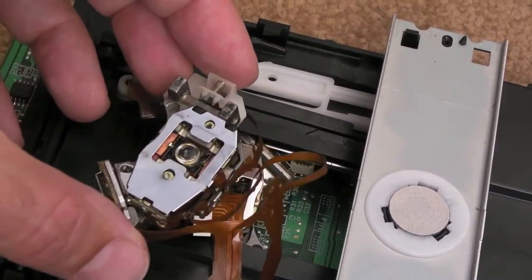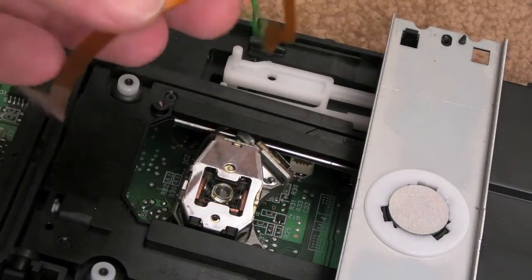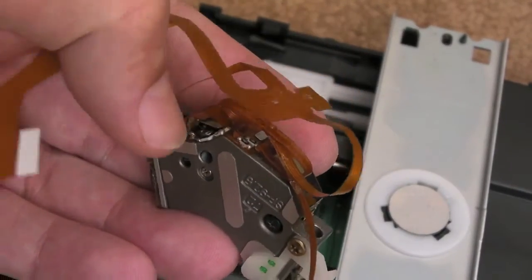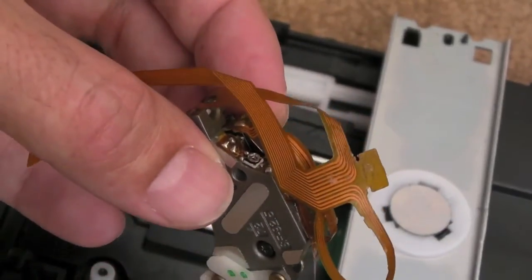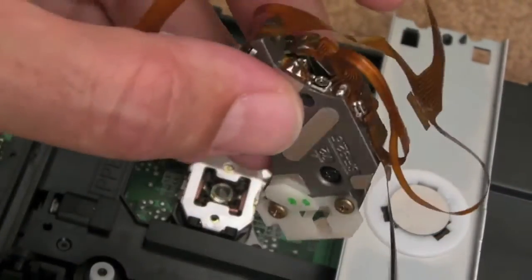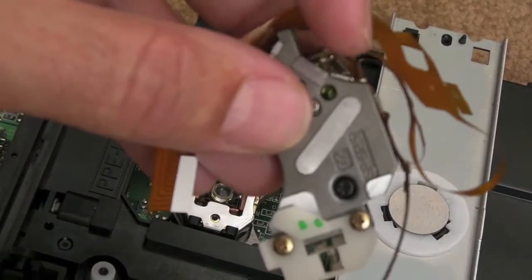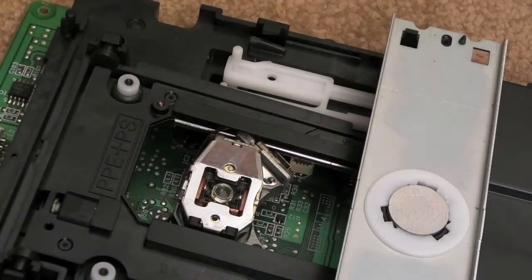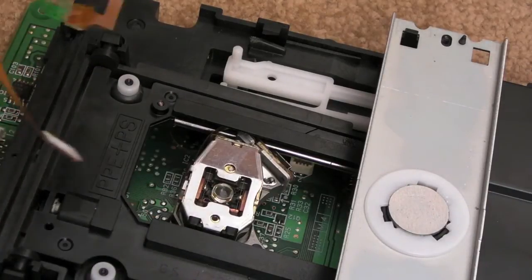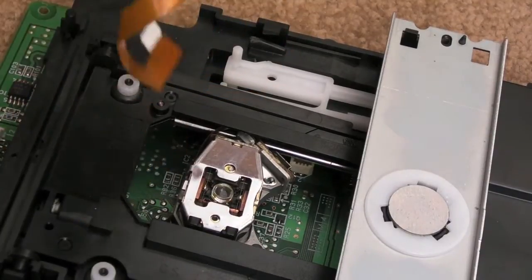If you've got a CD-based or DVD-based system, before you do anything — before you start tinkering with the original laser in terms of the pot — take a photo or make a mark somewhere on the pot at the position it's in. Measure and write down its resistance values in both directions, because you've got a common pin and the extremes of the resistance. When it's a larger pot, draw a line down the side of it to its base so you know exactly where it was. Then when you get your new laser, inspect it and compare the pot position to the original.